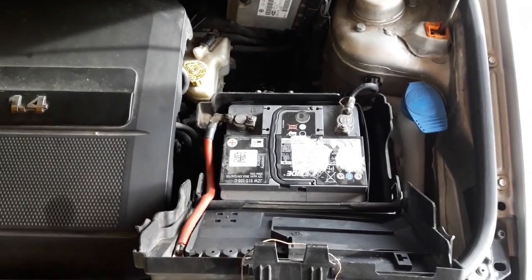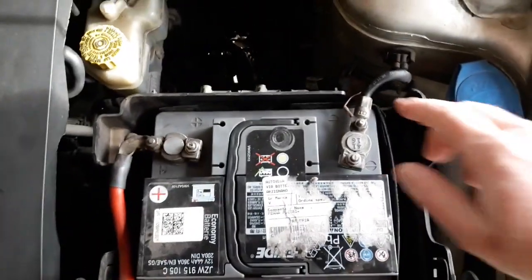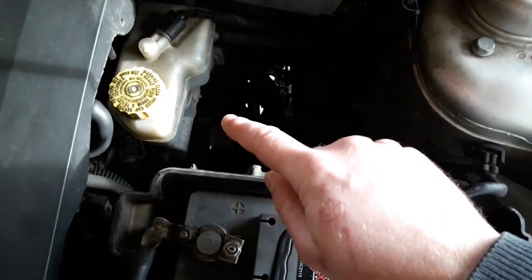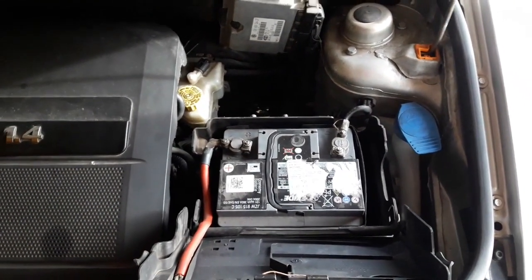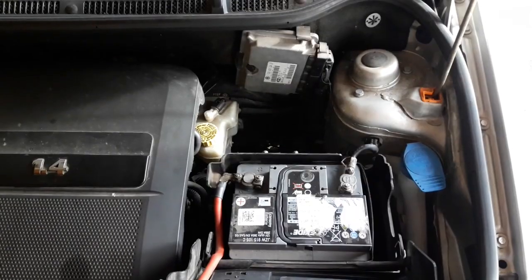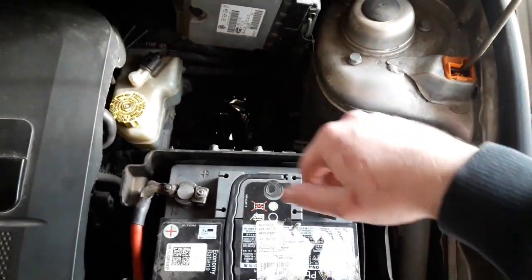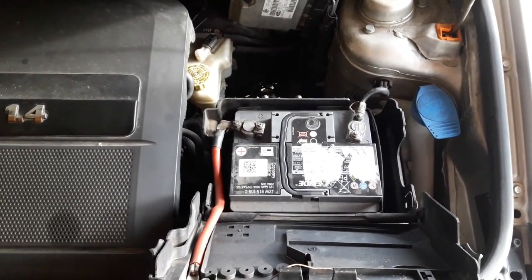What is a ground connection anyway? The ground connection on your car is the connection from the minus battery terminal to the car body, and from the car body to the engine. The electric system functions when there is a closed loop from plus to minus. In that loop is every electric appliance and system, so when the ground connection is bad or there is a weak contact, it causes interference in that loop and you'll experience problems.